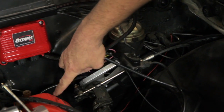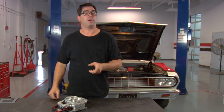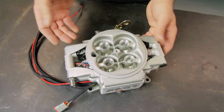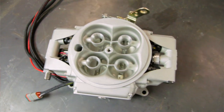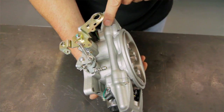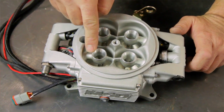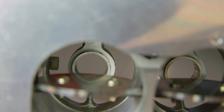The Chevelle is almost ready to jump into the 21st century — the carburetor is coming off and the fuel injector is going on. The MSD Atomic EFI throttle body features a modular, very clean design. The MAP sensor and TPS sensor are all built in, as are the fuel injectors feeding each of the Venturis from the corners. It's self-contained and sanitary. It requires less wiring, has a single fuel line, a crossover fuel rail, roller bearings for the throttle blade shafts, an integrated fuel pressure sensor, and precision-machined aluminum annular discharge rings that do an excellent job of atomizing fuel for maximum power and drivability.